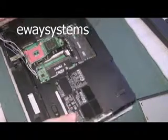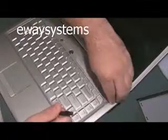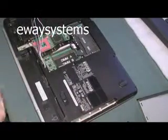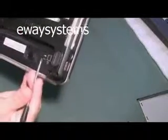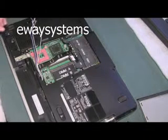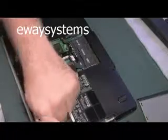Our goal now is to get onto the keyboard and get the screen off. Dells, in their usual fashion, have a little slot right here that you can put a screwdriver in and pry it up. That's going to allow us to pull this panel off, which I call the hinge cover plate, and this will get access to the keyboard and the screen. It's giving me a little bit of a problem, so I think these screws are holding it in. The screws are labeled, which is good — we know where they go. A lot of computers, Toshibas mainly, have labels next to the screw holes so you know which screws to take out.